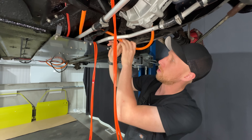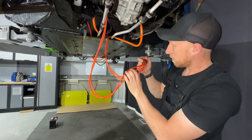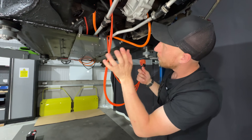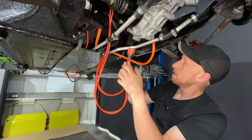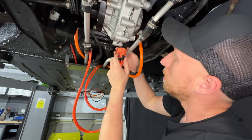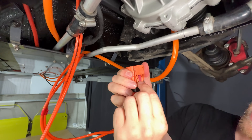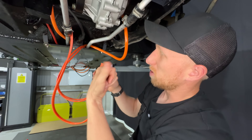All the excess cabling will feed back down the back of the vehicle. We have this connector here which is charger, DC-DC and PTC cabin heater — one side routes up to the cabin, the other side routes down to the charger DC-DC. This loops back up and plugs in next to the previous one. Once again it's a two-stage release — you pull that out, push that one down, then push that one down to actually remove it. Those are now in.